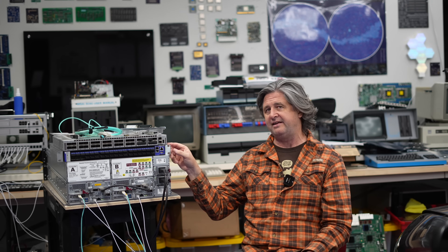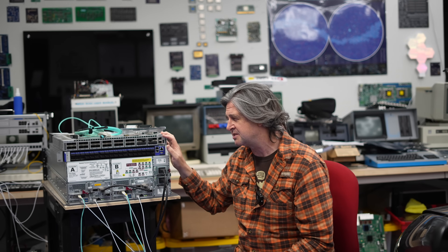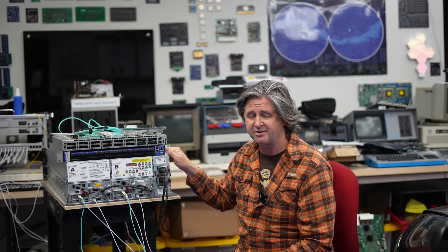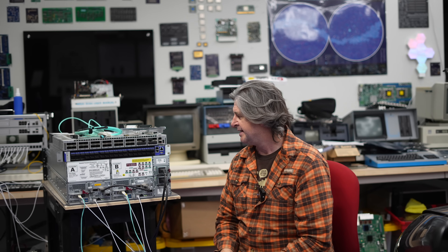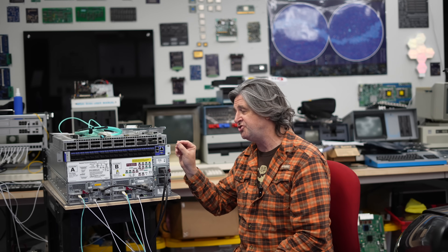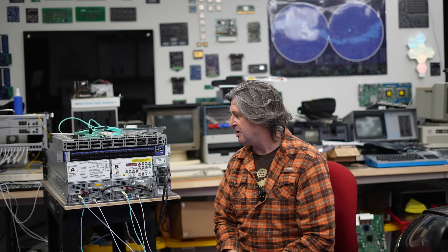If you want four or five machines on a real 40 gig network, you'll need a switch. I have two relatively cheap eBay switches here: a Mellanox SX6036, which has 36 QSFP+ ports, and an Arista 7050, which has 32 ports. Both retired from data centers — the Mellanox is maybe $300. A lot of Mellanox switches were sold for InfiniBand use and need a license key installed to do 40 gig Ethernet, but there's a well-known way to do this without special tools that you can Google pretty easily.